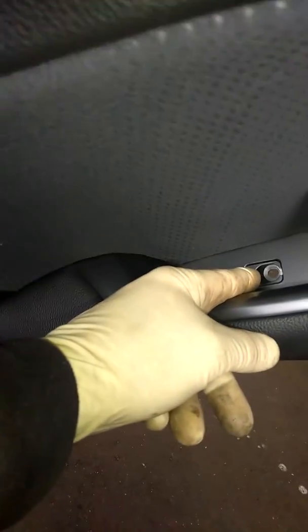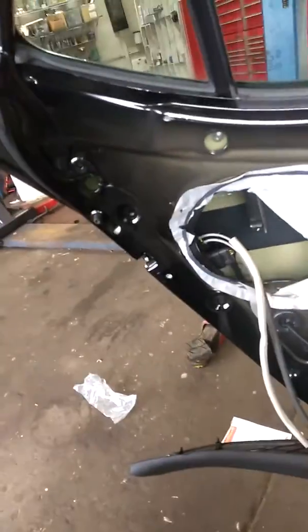So how you do that is you take the door panel off. There's a cover and a screw here, and a cover and a screw there. Then you slide the door panel off. There's an access hole here, and you can use a Phillips screwdriver to unscrew that. Then you take this cap off, and that'll allow you to pull this out and slide it back so you can inspect to see if this piece is broken. Then repeat the process in reverse.